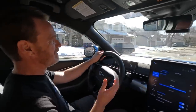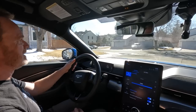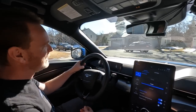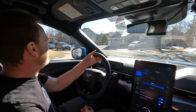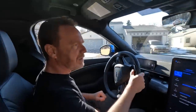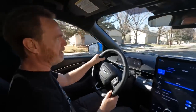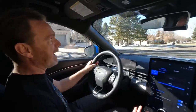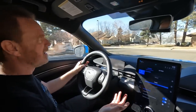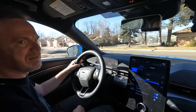The brake coach can be a bit of a challenge. Every time I have it in engaged mode and come up to a stop sign, I glance down and wait for it to pop up — 100% energy return. If I get anything below 90%, I feel bad. It happens, especially at stoplights where the light turns yellow and you need to make a sudden stop, so you use the friction brakes and get like 78%. But other times I enjoy trying to see if I can get 100% every single time.